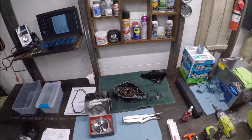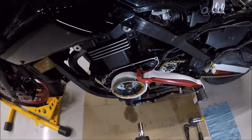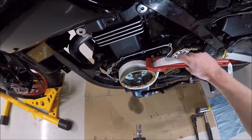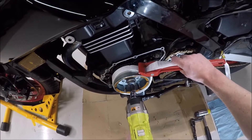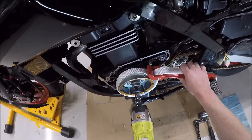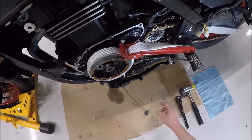I ended up painting that piece and the cover with Rust-Oleum and then Spray Max 2K clear over the top. To get the flywheel off, I don't want to go left — I want to go right — and I hold it with the strap wrench so it doesn't move. This thing is torqued down to 51 foot-pounds, so I'll need the strap wrench again when reinstalling.